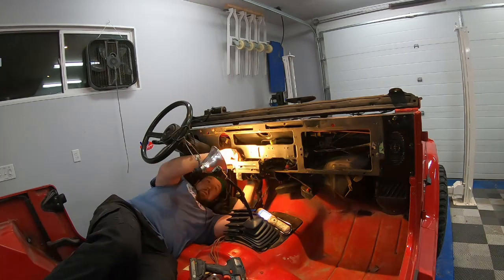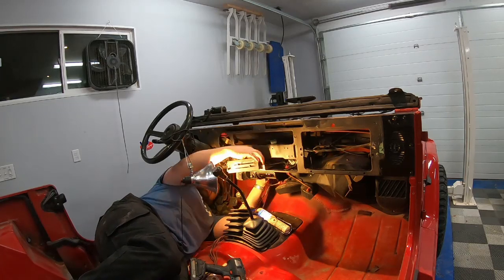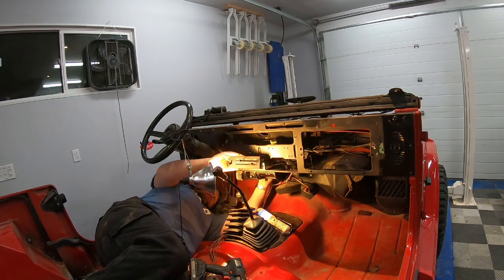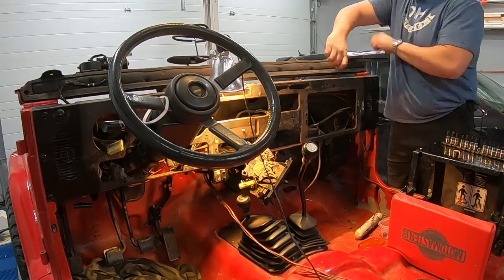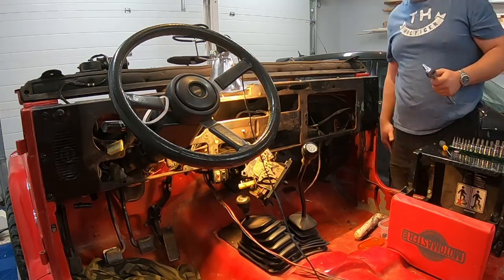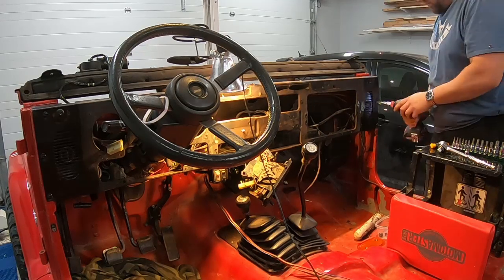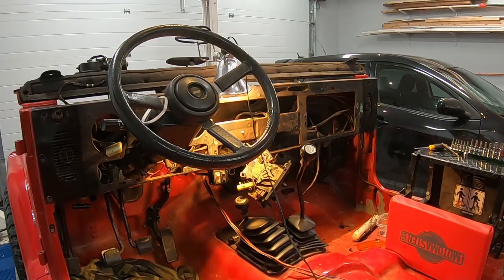Jumping back in on the other side, working on the climate control system — this is all old-school analog, just cables and levers. The cables are held in with small plastic inserts, and those things are basically ready to shatter; they're hard to replace too, so you want to be careful when you take those out. This is what I call the dash plate — basically the backer of the dash. Along the top you had to spray these down a lot with PB Blaster. And you'll notice by my changes of outfits throughout this next bit of video just how many days I had to work on getting those handful of screws out.